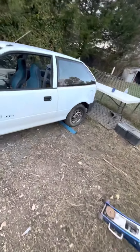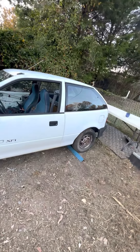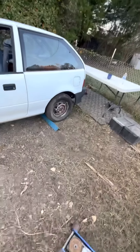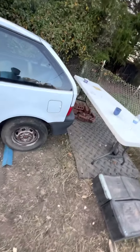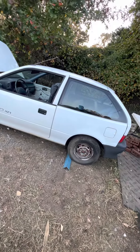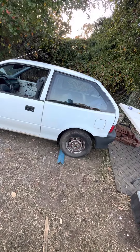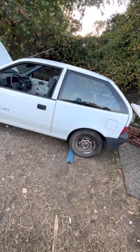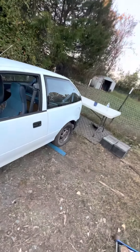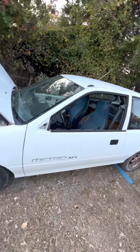Where I left off, I figured out that the fuel pump wasn't working. Pulled the tank out — it had been so corroded from old fuel and rust and all that good stuff. Had a hard time finding a new one, went to the junkyard and found a fuel pump assembly. Cleaned this tank out, put a new pump itself inside of the used assembly, put some new fuel lines on it, new clamps, hardware, some better connections — and she started right up.